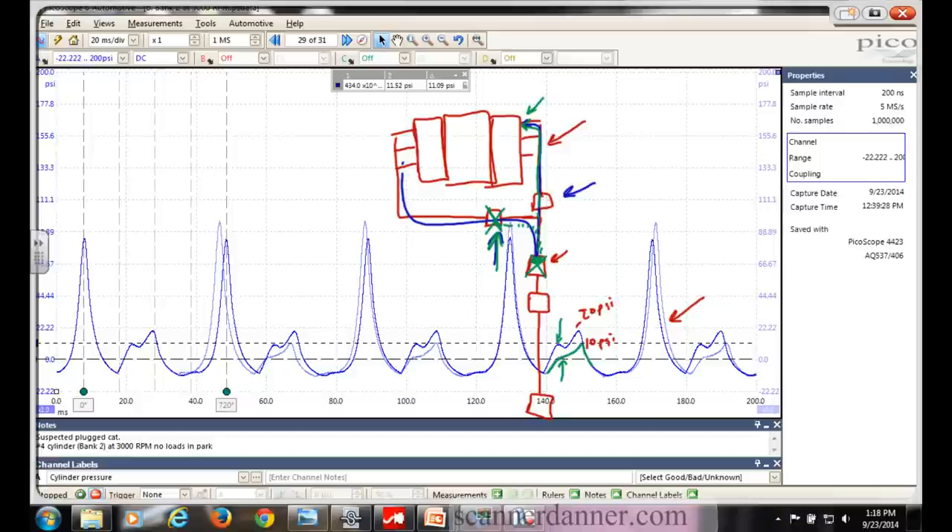What are our options to save Chris money? I think the only option is to literally drill a hole here and take a back pressure measurement, and drill a hole here and take another back pressure measurement. I know for a fact we're changing the front ones. If it was only a back cat issue, wouldn't my pressures be pretty close to the same on both sides? I'm seeing a pressure difference of 10 psi, and that alone is telling me the front ones are an issue - not just a back one.